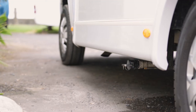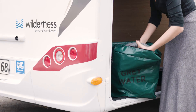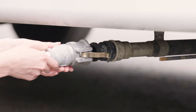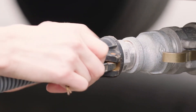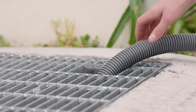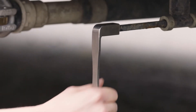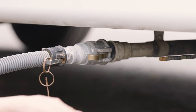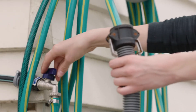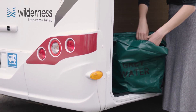You can empty your grey water tank and refill with fresh water at any approved dump station. Check your smartphone app for dump station locations. Your grey water outlet is located on the passenger side of the vehicle. Park the motorhome as close as you can to the grey water drain. Find the hose bag in the external storage locker and remove the grey water hose. There may be an adapter you need to attach to the outlet for the hose to fit properly. Take the cap off, then attach the hose. Secure the hose by pulling the clips towards you. Put the other end of the hose in the drain. Attach the tap handle firmly to the grey water tap beside the outlet. Turn the handle 90 degrees anti-clockwise to open and allow the grey water to drain out. Once the grey water has finished draining, turn the tap off by turning the handle 90 degrees clockwise. Detach the hose and hold up the end that connects to the tap to drain out the last of the water. Flush the hose with fresh water, then clip the ends together. Return the hose to the bag and stow it. Make sure you return the grey water hose to the same side of the hose bag as you found it to prevent contamination.